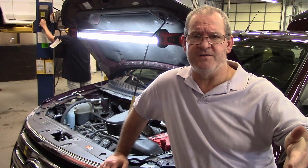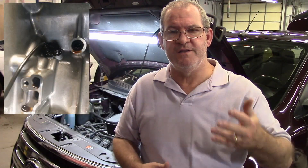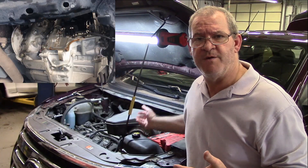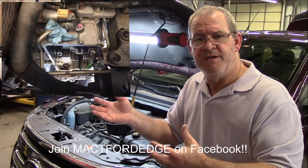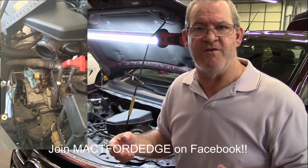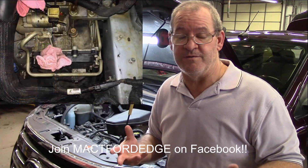As you can see in some of these photos paging through here, getting to the sensors is not that hard. They are located underneath your air box. You take the air box out and you can crawl underneath, and you can also work from the top. There's a front panel you'll have to undo to get to them. It's not that hard of a job, and you can't use power tools — it is really a hand tool job.